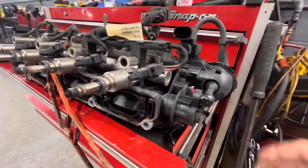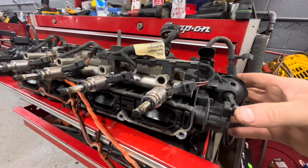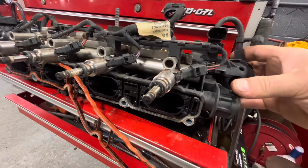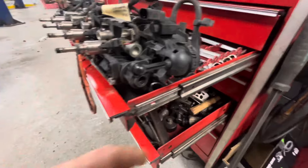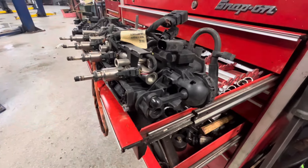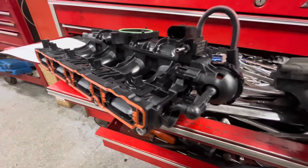What they think happened is the mechanism itself kind of gets banged out and falls apart. The pivot — you'll see on a lot of these — the arm is just totally falling off and the pivot is pulled out. A lot of it's because when vacuum is let off, or when pressure is let off at the solenoid, this thing slams shut. It's a pretty violent thing to be happening over and over. It's just the way this design works — there's a spring in here and there's nothing to dampen that.